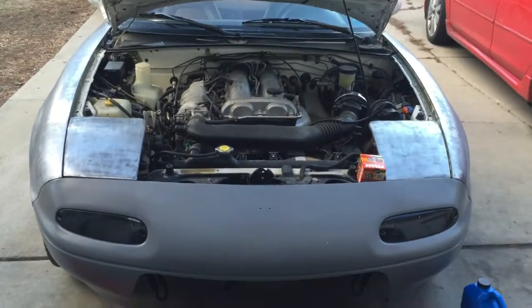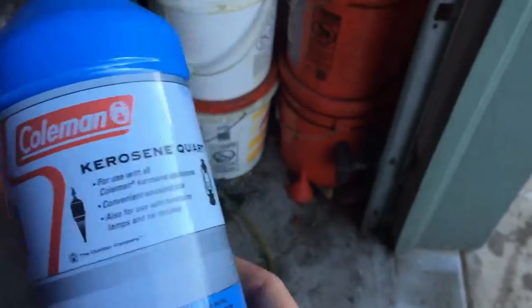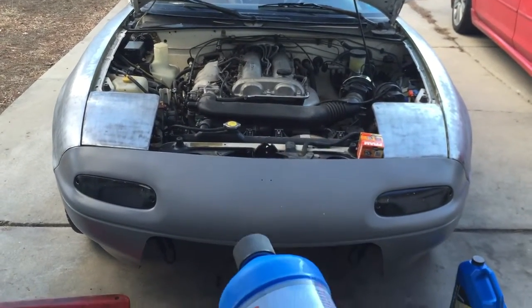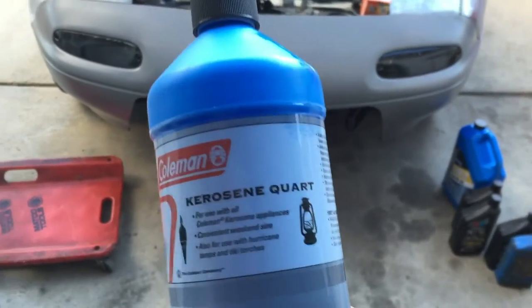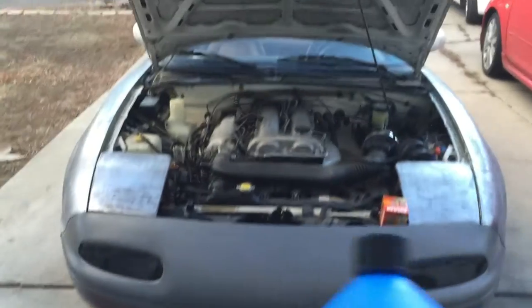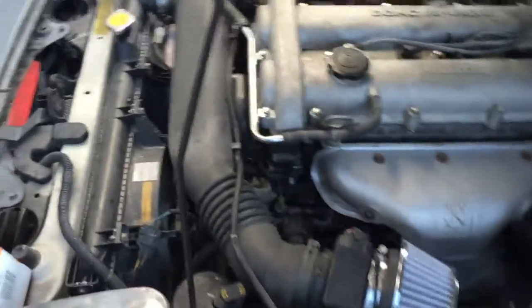It's kind of an old school trick. Drain about half your oil, depending on the size of the motor, and throw a couple of quarts of kerosene in there. And for everybody that's gonna say, 'Oh my god, but that's flammable!' — so is oil. The drip-down gasoline that gets past your rings into your oil gallery makes more vapor and more explosive vapor than kerosene ever could. Grandpappy and all the old school guys recommended this on tractors, cars, and trucks forever. Let the car idle until it gets to operating temperature — basically once your fans kick on.